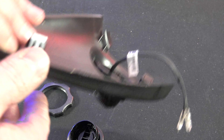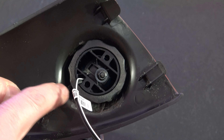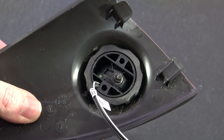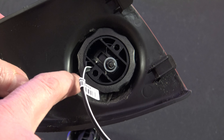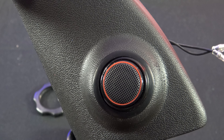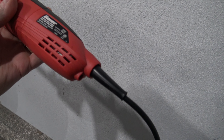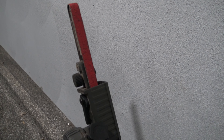Here's what it looks like up close, and here's what it looks like in the back. You do have some ribs right here that you need to grind out. I have a little electric dyna file — I'll put a link in the description to that tool — all different kinds of uses around the house for it, and it's kind of like a finger file. You just get in there and grind that out of your way. This is attached with a large nut, and you have a small nut for your pivot point — it's not going to go anywhere. This is what the finger sander looks like: it's nice and thin, only about a half inch wide. It just plugs into a normal household outlet. I use it to get down inside there and grind those three little plastic tabs off.